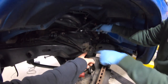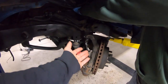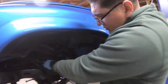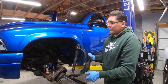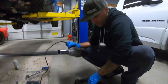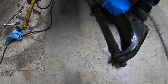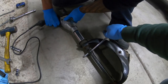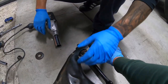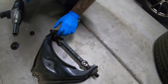Jonathan's over here - we're going full send. We're going to remove the two bolts, remove the brake line, remove the upper ball joint three bolts, take the upper control arm off. We'll do the top first then the bottom so we don't have to completely drop the spindle. We couldn't crack that bolt loose - we needed the crescent wrench. We put PB Blaster on those, so that made it easy.